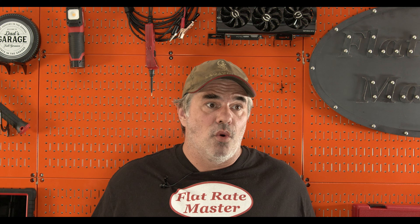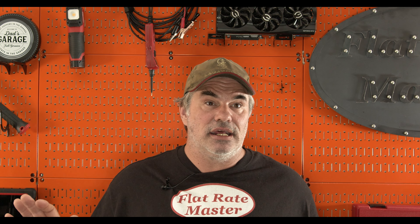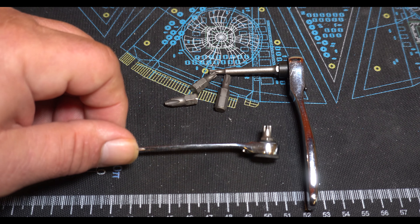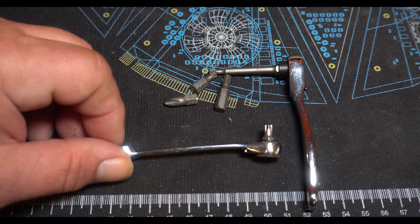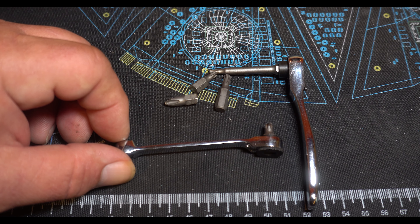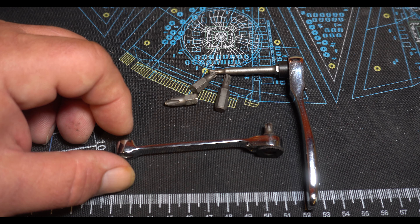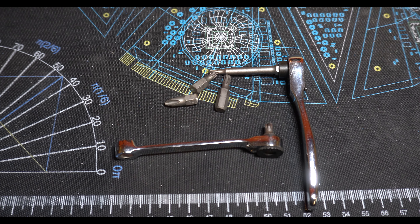This is a really great set just to have around for these kind of jobs where you need to modify something just a little bit to get in there. Even with the little shallow ones, I run into them with the ratchet — it's just too thick. Even with any combination of little quarter-inch ratchets I've got, you grind it down and all of a sudden you have the perfect depth. I can't tell you how many blend door actuators I've done this for — just enough clearance to get around the body of the actuator but actually be able to turn it and ratchet it rather than hitting against an obstruction.